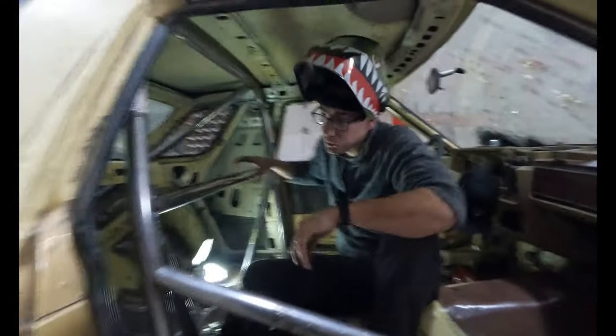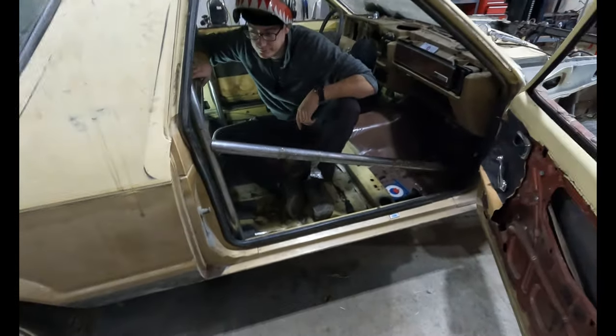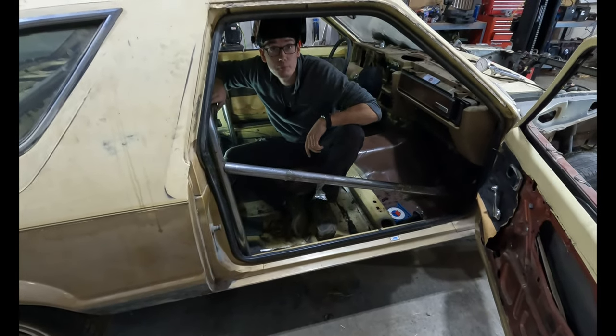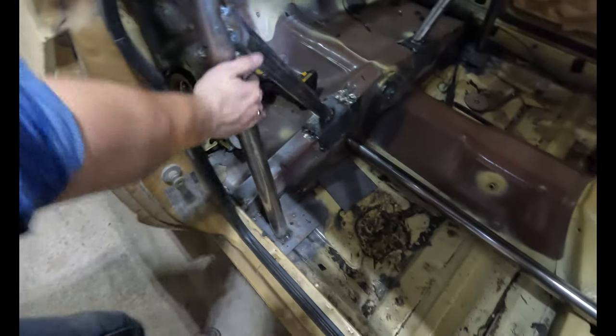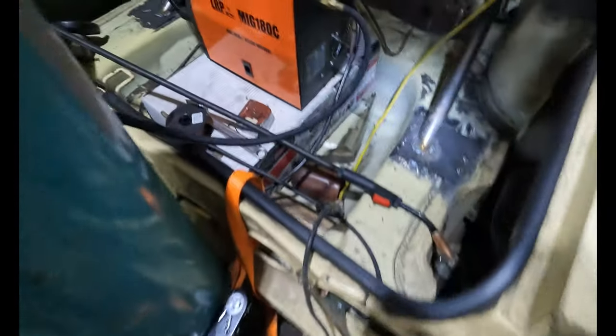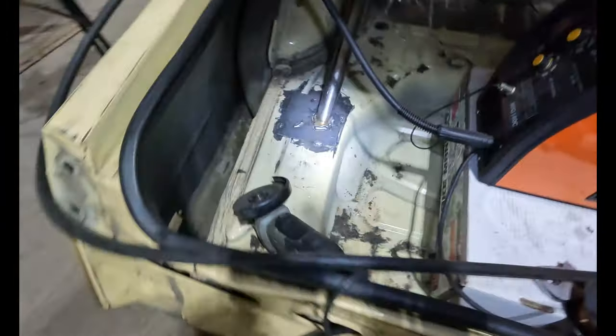Should we roll it? That kind of just leaves door bars. We're proud of the progress we made for sure. It doesn't look tons different, but it is. We've got a couple passes of welds to do now, but you could roll the car. It's solid — we actually did good. We're exactly to within a degree, the same on both sides. How could you tell that? With the digital angle finder.